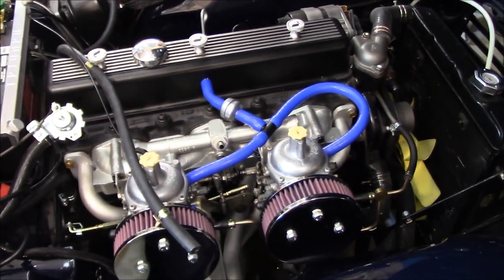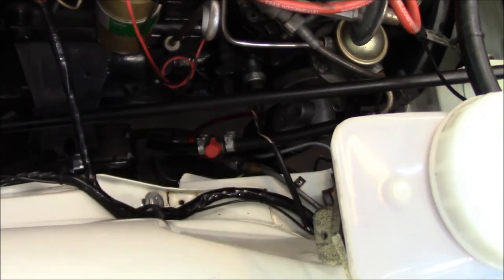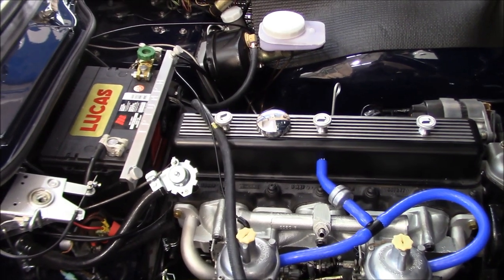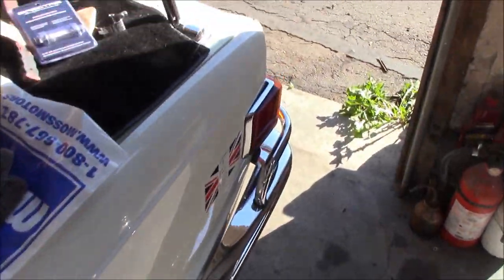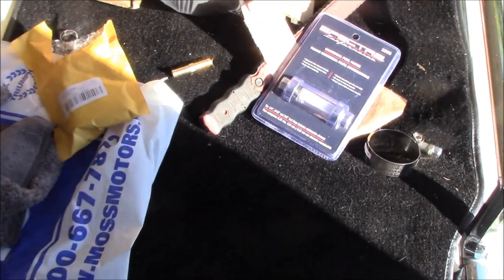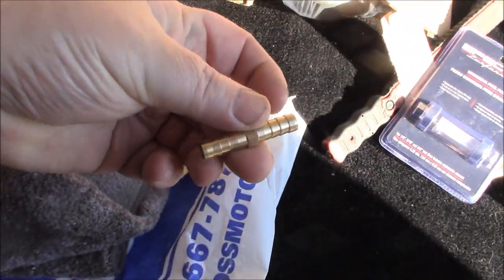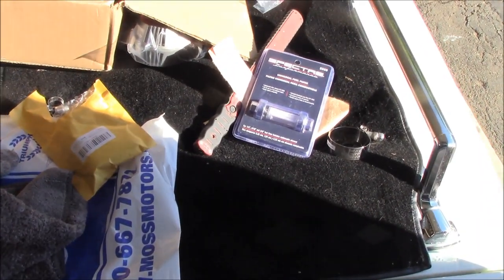One of the other things I want to do is rejig the inline fuel shutoff valve that I installed on the 250 to make it a little bit more accessible. I like the location on the TR6 which is out in the open and easily reachable. I wasn't happy with the way I installed it on the 250 initially - that was primarily due to the length of the flexible rubber hose coming off the hard line. I need to extend that, so I've got a little adapter to add another piece of hose to get the valve into a more accessible location.